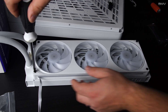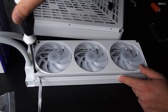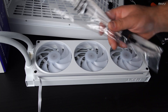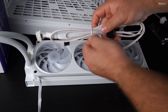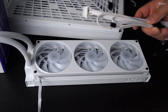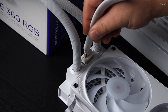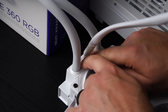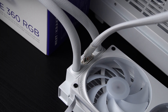If you feel a little bit of resistance on a screw, pull back and start over — that could be cross-threading and you don't want to do that. Now the final step before this goes into the case: connect the breakout cable set. It's a cluster of cables with one connector, which is really nice. It plugs in right in between the pipes — just line it up and push down. There's no satisfying click; it just sits flush with the little block.